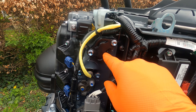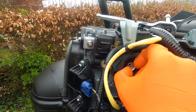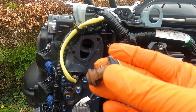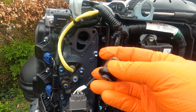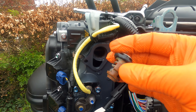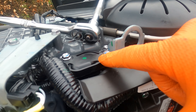We'll do the left one first, take it, have a look at it, and we'll change the gasket as well. Just take the cover off there — that's the thermostat there — and it's just a case of popping them out with your fingers and inspecting them. Obviously you can test them in hot water, but this one is not in really good condition. For installation it goes back in, with a cover and an o-ring that sits in there, which we'll change, and then we'll do the same for the top one.